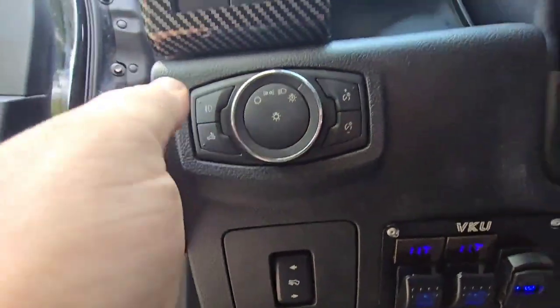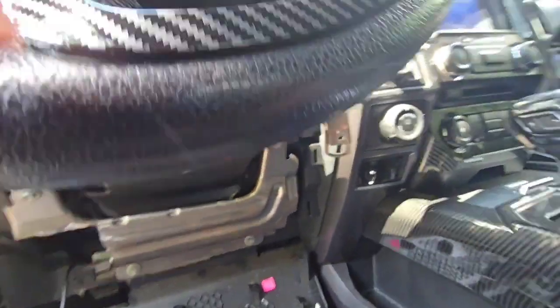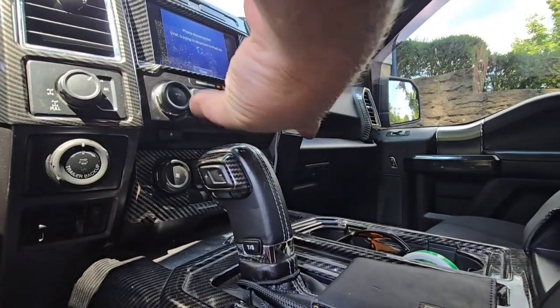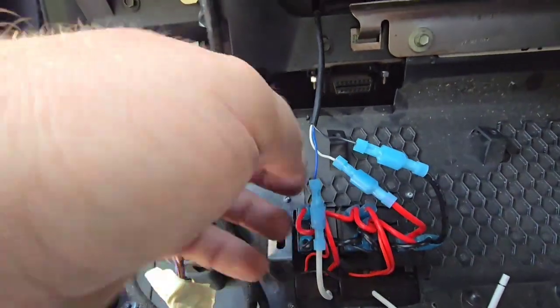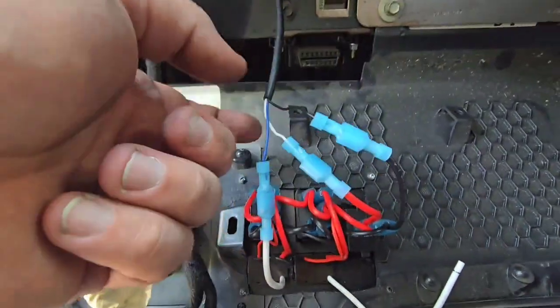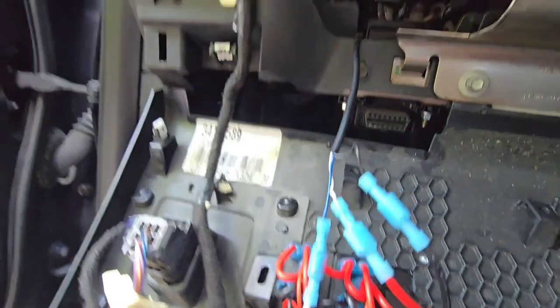This panel here is probably going to be the same for every vehicle — it just pops off with some clips. Depending on what kind of vehicle you have, some people mount the switch panel in the headliner, some mount it here if they don't have any factory switches, or maybe on the other side. That wouldn't be bad for a one or two switch setup. This is how it's wired in: the wire they gave me goes black to black for ground, blue to white, and white to red. I only ran it through there, and it comes in through here.